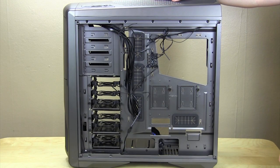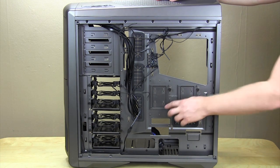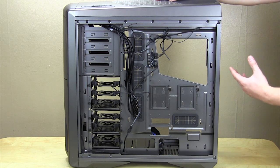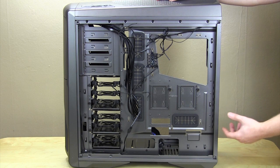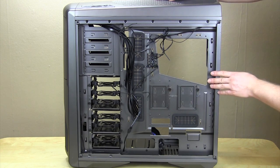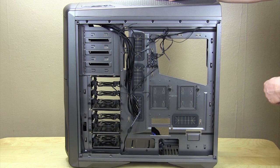I've taken the opposite side panel off the case just so you can see how everything is laid out. The things that really jump out to me about the backside of the case are the two hard drive trays right here — this supports a two and a half inch drive, so they can be completely behind your motherboard and completely out of the way. It gives you more room for hard drives, which is great if you're loading up your system. These are easily removable with two thumb screws — you can pull them out, install your drive, and you're pretty much good to go. There's also your fan hub here, which supports three-pin fans. It's a central location so you can plug everything into it, and it of course plugs into power.